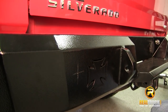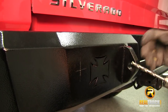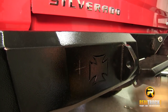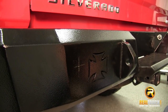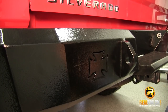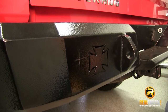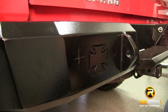The next thing we're going to do is start drilling. We're going to start out with a small size bit — something nice and sharp that's going to cut through this heavy gauge metal really well. Then we'll jump up to a half inch bit and drill it out to half inch. After that, we're going to get a step bit and just start stepping that up until we have about an inch and an eighth for these particular sensors. Let's start drilling these out.